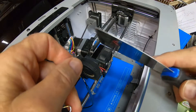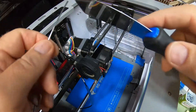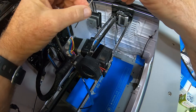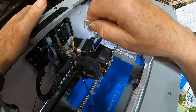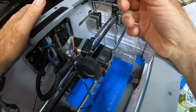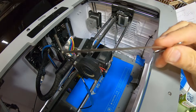I did that off camera using the spatula that came with the printer to scrape it off, because it hardens within about five seconds — you have to scrape it off right away or it doesn't work. You can always stick it back in and re-melt it. The whole idea is to get the filament out of the heat break tube. By spinning the rod you're getting more filament out. Usually two pushes is about all you can get.